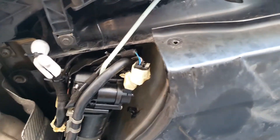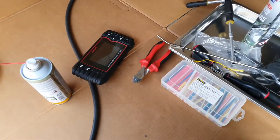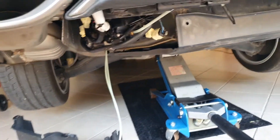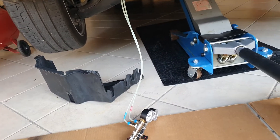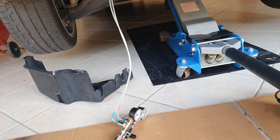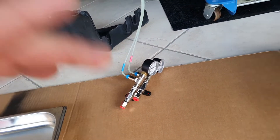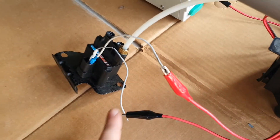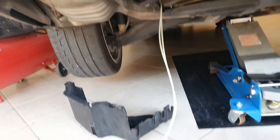What is important is that the compressor works with clean air. Right here is the release valve. In my case I've disconnected all the electrical cables, so rather than using a scanner, I want to do some very basic checks. I've disconnected everything and I'm trying to check the mechanical side of the system. These two lines move from this main valve to the two air bags on the two sides.